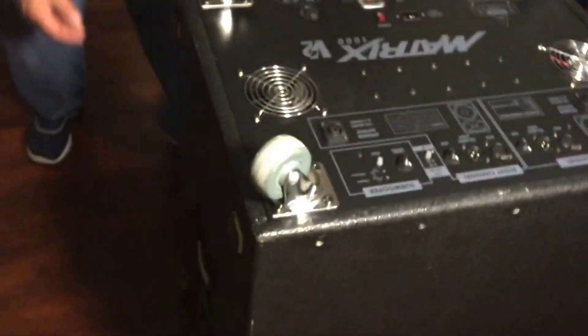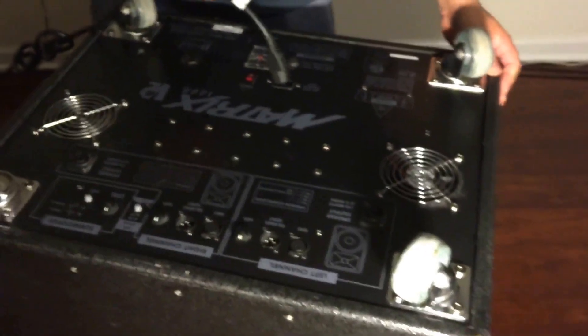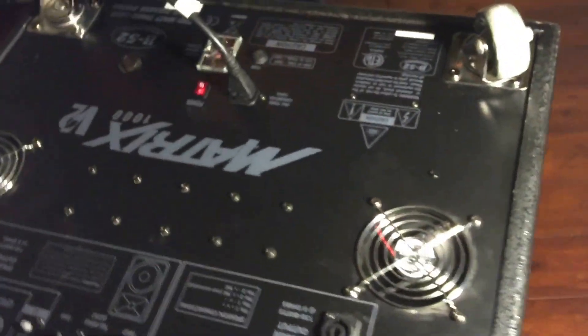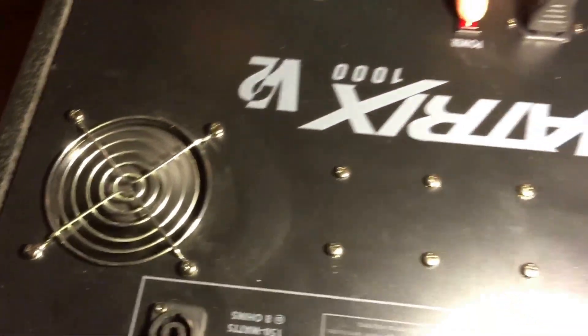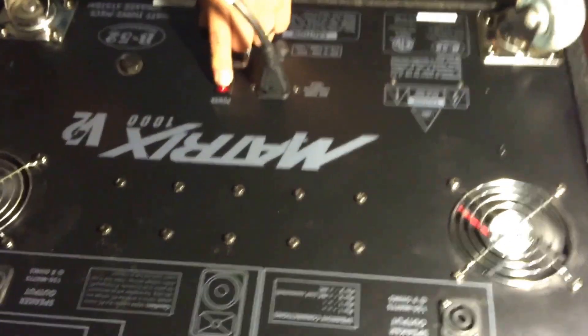To test it, we put the power cable in but we're not going to put the screws back in yet — we just want to test first. Once we make the connection, we power it on and the fans are working. You have now changed the fuse and that was the problem. This was not working for a long time and I was very nervous my equipment would get damaged, but after a few minutes we're finally back in business and ready to play music.